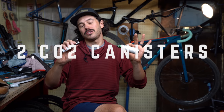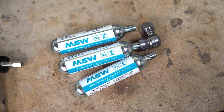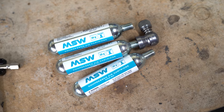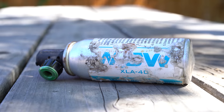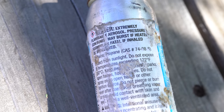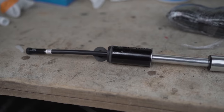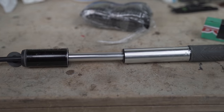Next up is CO2. It can be great for day rides and especially when you're trying to reseat a tubeless tire, but you definitely shouldn't rely on it. CO2 is heavy and it doesn't work very well with tubeless systems. I rarely ever carry CO2, but I do carry this — it used to be called Big Air and now MSW produces it. It's like a propane mixture, so I'll use this for really stubborn tires if I'm looking to reseat the tire after, say, stitching a sidewall. But really, I'm relying on my hand pump — and a quality hand pump at that.